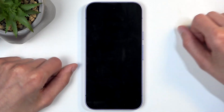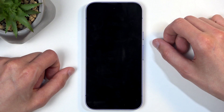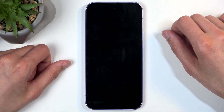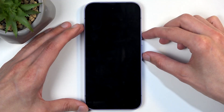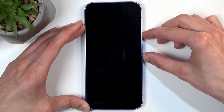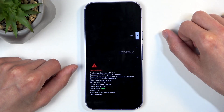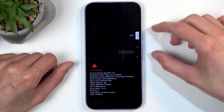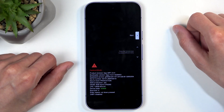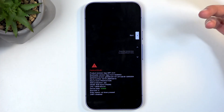It's basically like a reset button on a computer. You're going to continue holding these buttons until the device starts to boot up and takes you to the bootloader. So, power button and volume down. You do want to give the device a solid 5 to 10 seconds after it turns off, as holding these two buttons too quickly after selecting power off sometimes results in the device not doing anything.